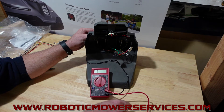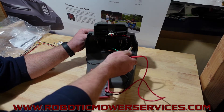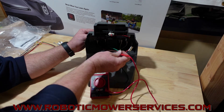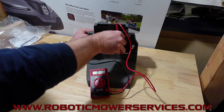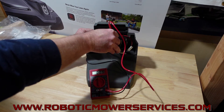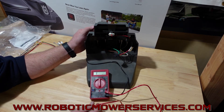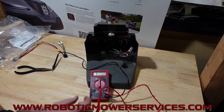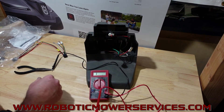Get the meter up where you can see it. This is the brown wire, so we're going to find the brown wire in our harness. And what do we got? There we go — 0.9 ohms. So we are good the whole way from this connector all the way through to the outside. We have no issues there. And you just do that with all the different wires going through there to make sure everything's good in the harness.